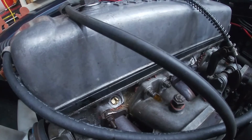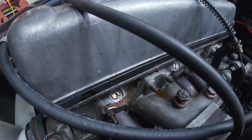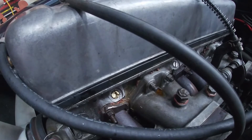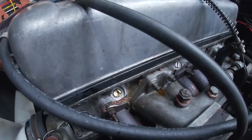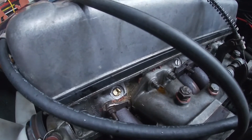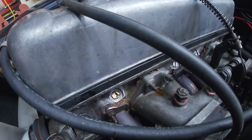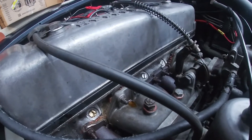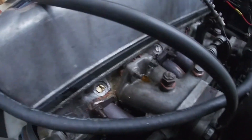I'm afraid that if I drill any further in, it's just going to drop brass shavings into my cylinders, and that would not be pleasant. So the next option is to remove the head, drill out the plug, and reinsert a new plug. These are actually smog inlet or outlet orifices that are no longer used. We put these plugs in to eliminate a chirping resonance that comes through the cylinder head — kind of makes the car sound like a spaceship out of the Jetsons. I got three out of four done, and this last one not so much.